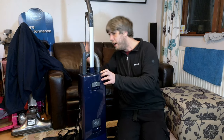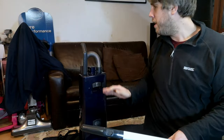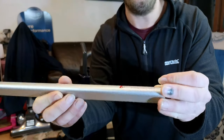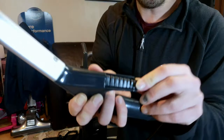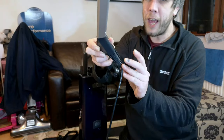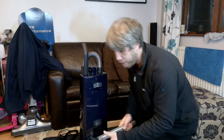We'll start up here and work down. We have our standard handle, our standard cable. If we move that latch and pull this out, it's actually not too bad. The signs of a heavily used Sebo vacuum cleaner: this bit is just worn smooth and scratched up and scuffed where it sits, moving ever so slightly in the handle. The cable grommet is okay — it's starting to break on the third one where they always go. But that's fine, because when the cable breaks you can chop that down and put the cable back in.